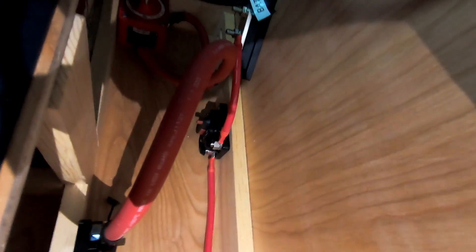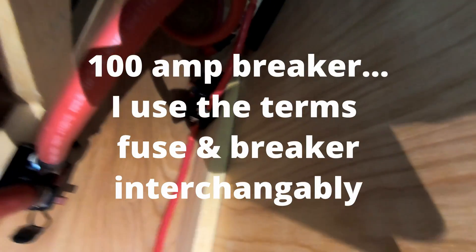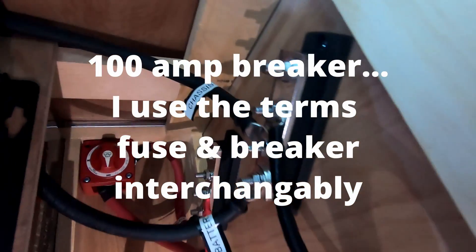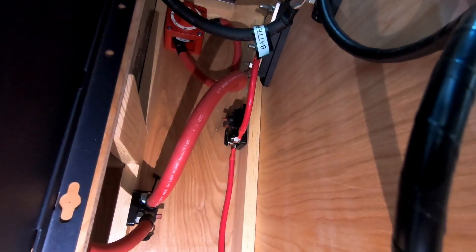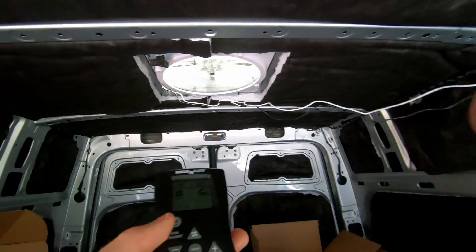We have the 12 volt fuse box installed, behind a 100 amp fuse at the bottom. It attaches directly to the positive bus bar, goes into the fuse block, and then goes back through the negative bus bar which is grounded and connected to the battery bank. It gets power when the switch is turned on and loses power when the switch is turned off or when the fuse blows — this is actually a breaker, not a fuse, so it's resettable. The very first electrical component we're going to connect is the MaxAir fan. Today is a perfect day to get it working because it's over 100 degrees outside. Yeehaw brothers, we now have power!